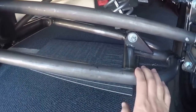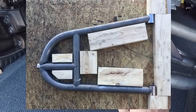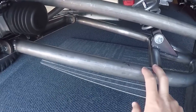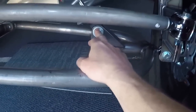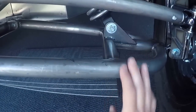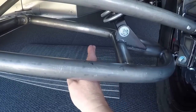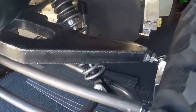Once I had that, it was just a matter of taking measurements from my pivot points on the spindles and on the chassis. Then I created a jig out of some 2x4s and plywood and welded up the lower control arm. I did for the most part guess roughly where I wanted the shock absorber to connect. In hindsight, I should have moved it in a little bit farther — back to about here — because these are 10-inch travel shock absorbers and they are what's limiting me from getting maximum travel out of this setup.